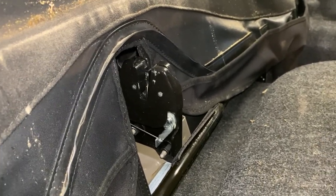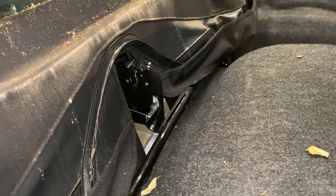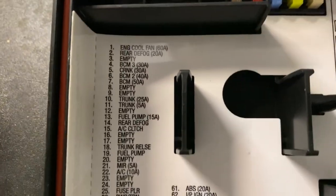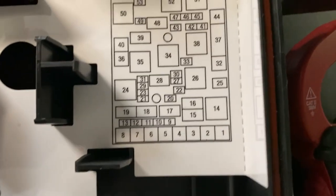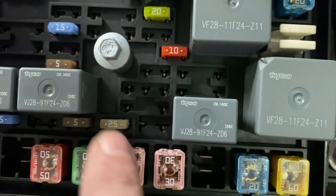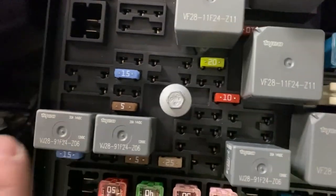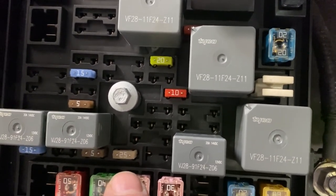If we pull our inside one here, we can see that it pulls just as well. I'm right now pulling the latch that we looked at earlier, so we know that mechanism is actually working. We just gotta figure out where the electronics are and track down if that's a good relay, good servo, whatever it is that's actually pulling that. Digging into our fuse diagram, the first thing to check is we've got a trunk fuse — a 25 amp and a 5 amp — and then we've got a trunk release relay at position 18. Positions 9 and 10 are in this bottom row and 18 is right above it. So first let's test continuity on those two and see if the fuses are actually good, then we'll test the relay. If all this checks out, it might be a bad actuator itself. So let's test all those.